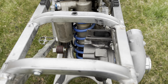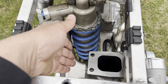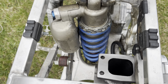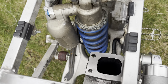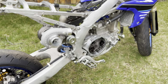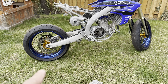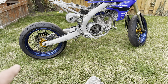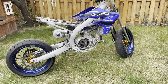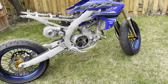I think I'll just leave the T25 flange on here - they actually make some T25 flanges with outer bolt holes that serve as a mounting plate, so I'll probably go that direction. Before I make any mounts, I'm going to throw on my dirt tire because my Warp 9s are 17-inch and my dirt tire is a 19-inch, so I want to make sure there won't be any clearance issues between the tire and the turbo. I highly doubt it but I'd rather be safe than sorry.